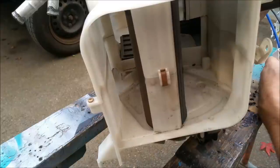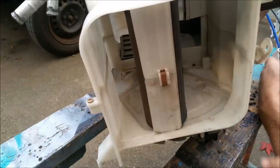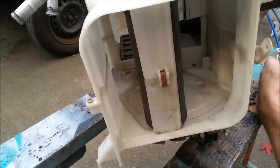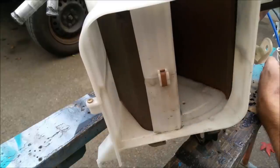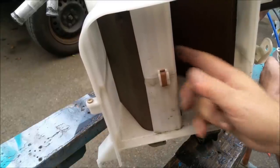That is the setting you'd have it on if the air conditioner was here, right? The air conditioner fits here and the fan's on the other side of it, so when you want cold from your air conditioning, you're blocking the core off. The air conditioning will be on anyway if you have it on defrost. It is a dehumidifier, but the cold air from the air conditioner will then pass through here and warm up.